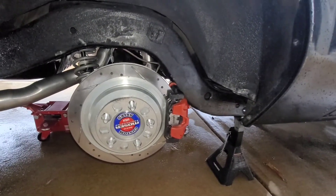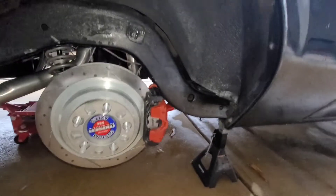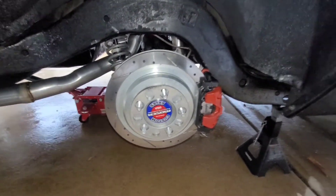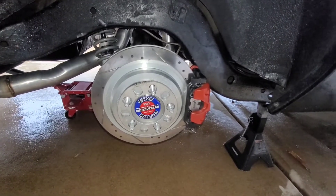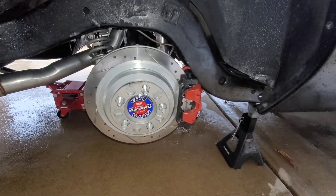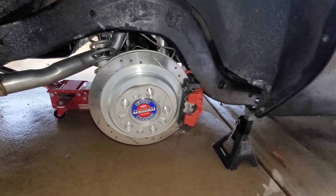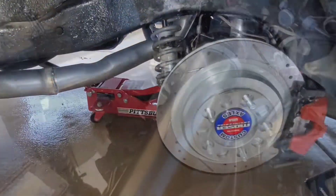I've been talking about getting the car painted and doing the interior forever, but once I do that I'll pretty much be done with the car — I'm not going to swap this one, only the 96 SS Impala. I'm going to finish bleeding this caliper, then lower the coilovers on the front, and then that'd be it for that part of the video. I'm going to take the car to the shop so they can put the bump steer kit on and realign the car.